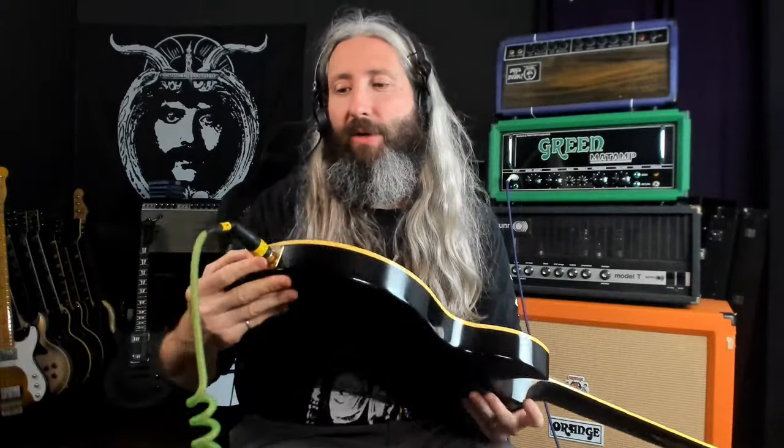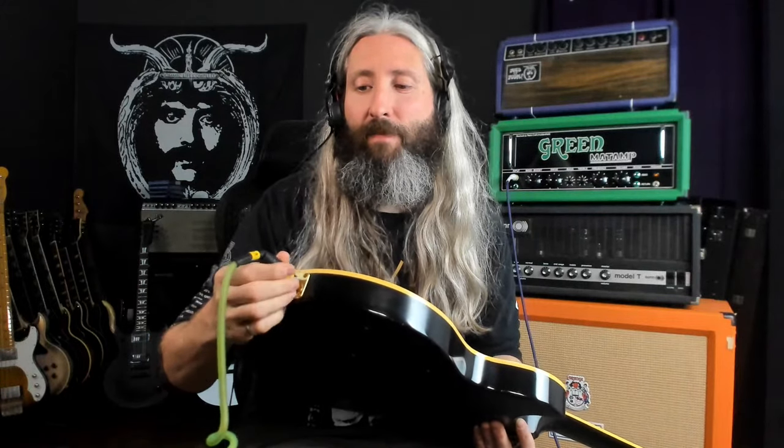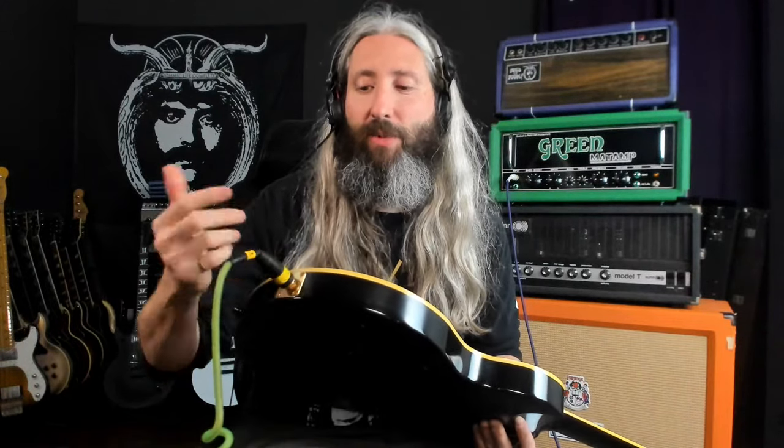But I couldn't get it to work, so I wish I would have thought of it during the stream, but I just grabbed some contact cleaner. For some reason, I figured there was something like a loose solder joint, but it was actually just an oxidized output jack. So I just sprayed some of that contact cleaner on the quarter inch and just kind of pushed the plug in and out. I sprayed some in the jack and now it works well. So